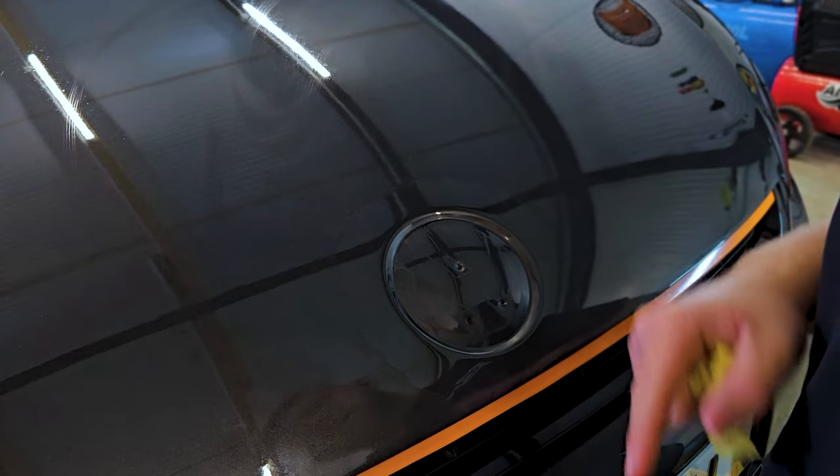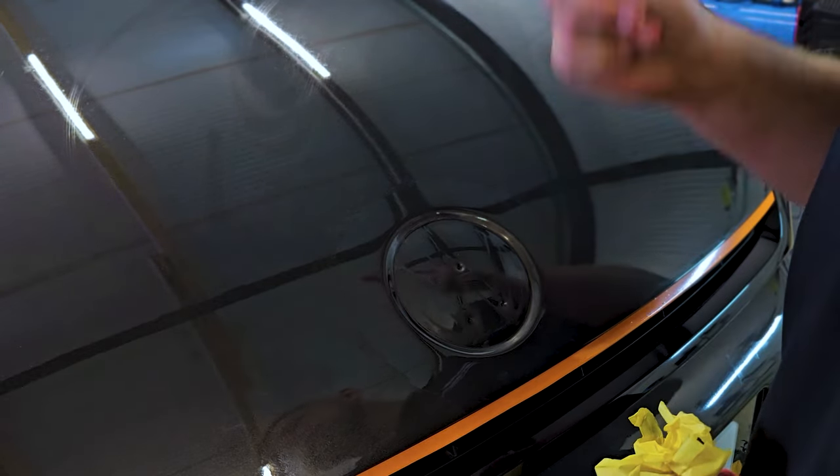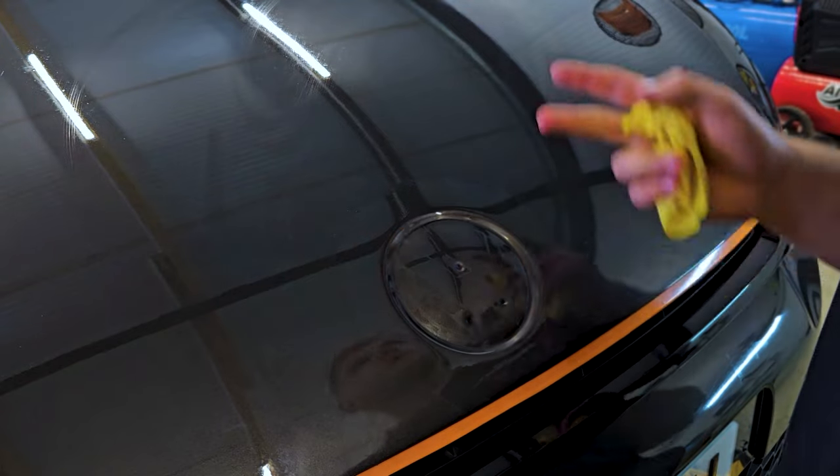And yeah, anyway, what I'm going to do now is remove the rear badge, pretty much the same concept. Right, so the badges at the front and at the rear are off, the eyelids are also off. It's easier to deal with the badges and that sort of stuff first, because then in the machine polishing process you can polish around the badge area without worrying about damaging the badge, and also below the badge it always leaves a bit of staining as well, so it's easy to remove when the badge is not there.